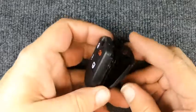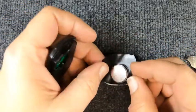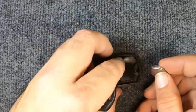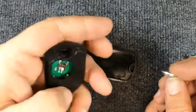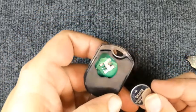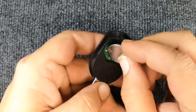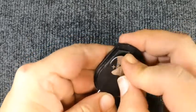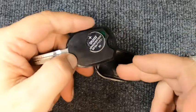The two halves open up. The back cover comes off, and a little rubber gasket may pop out and bring the battery out with it. You might get lucky and it comes out that way. This is your CR2032 battery. When you put it back in, you'll push inwards and down.